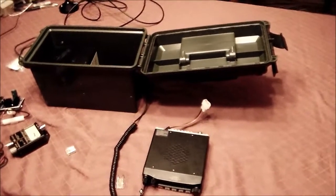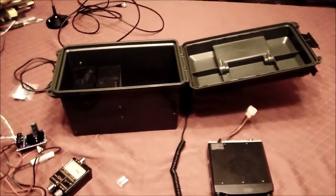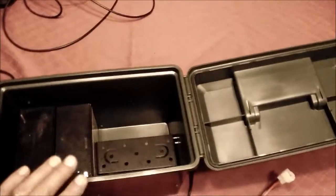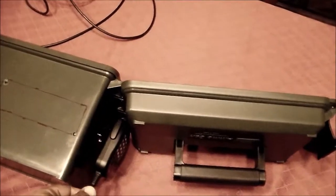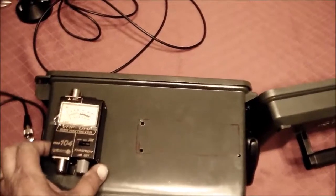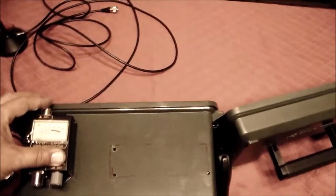I've got everything planned out, marked out, and I'm ready to go. I drilled a couple little test holes just to see that things will work. Inside here, I took the bracket normally used to mount this radio in a car and just flipped it upside down, and I put the two batteries in — it fits nice and snug. That's basically going to be where my radio sits, right on top. I marked out where I'm going to cut to put the radio in, and I mounted the clip for the mic to hang on the side. The radio is going to sit in there on top of that bracket, up tight against the batteries. And the SWR meter I'm going to mount right here, with the cable coming out the bottom going right into there, and then the antenna will attach to the top.